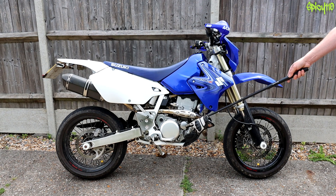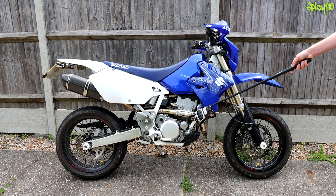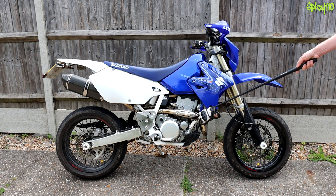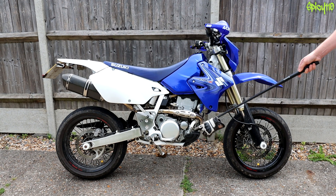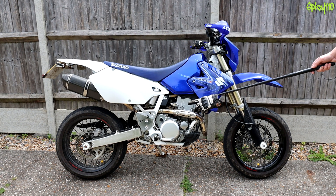In this area, on the opposite side of the bike, you're going to have a magneto and a stator. That's how the bike creates electricity. You have a magneto attached to your flywheel, which spins magnets around a copper star-shaped stator. As the magnets pass over it, electricity is created — that's what charges your bike, though not directly, and we'll get onto that in a moment.